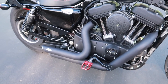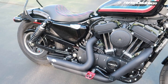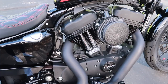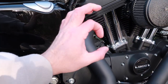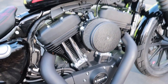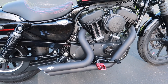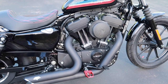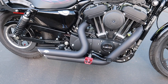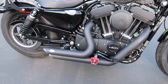On to the exhaust system — this is a Vance and Hines Short Shots Staggered exhaust system, got it in black. They sell it in black and chrome; I wanted to go black. When putting these on, you also want to make sure you change out the exhaust port gaskets, so I bought Vance and Hines gaskets and threw those in as well. It took me a couple hours to complete the project. I'm not a mechanic — this is my first time actually working on my own bike. A little bit of YouTube and you can do it yourself.